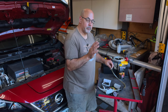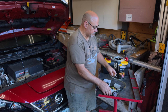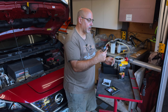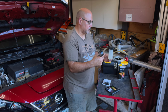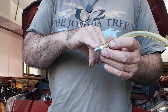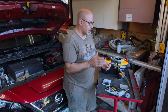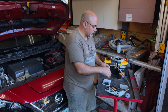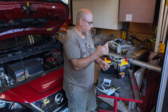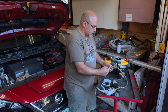If you hook up a vacuum bleeder, it's basically pulling a vacuum into this cup. If you pull a vacuum on this, not only does it pull a vacuum from this hole, but it also pulls a vacuum from around the threads. And if you're using a method where you've just got the hose hooked up — where people have a bottle full of fluid placed higher and keep pumping the pedal — the problem is that with this bleeder valve loose, it can suck air past these threads.